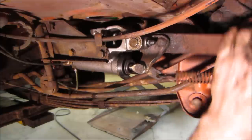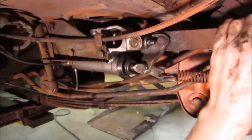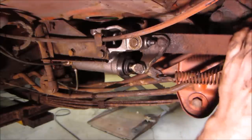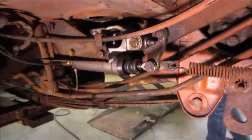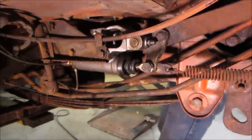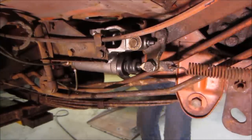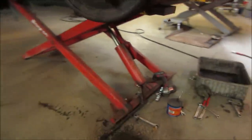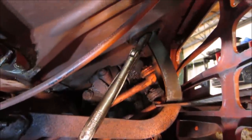I don't know if the bleeders are tight or loose going around. I need to check them. But I have a wrench on right behind us on that closest one. I'm gonna work that from the other side. Crack it loose so you can get some air out of it. That line that more than likely I left loose. Ah, feels tight. Not tight enough, apparently. So I have a loose line. I don't know if you guys can see. There you go. Took care of that.